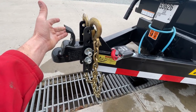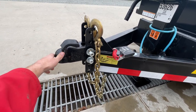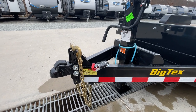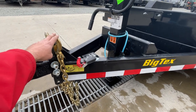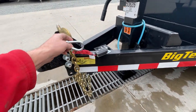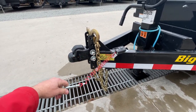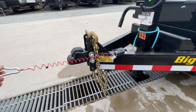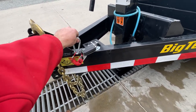If you're not familiar, these just lift up and glide down as you put the jack down on the ball. The safety chain holder is farther back under the Big Tex logo, but up here is actually a pretty convenient place to put them as well. You've got your zip breakaway cable — these are nice because they give you flexibility and pull out the slack so nobody's dragging them down on the road and getting them torn up.